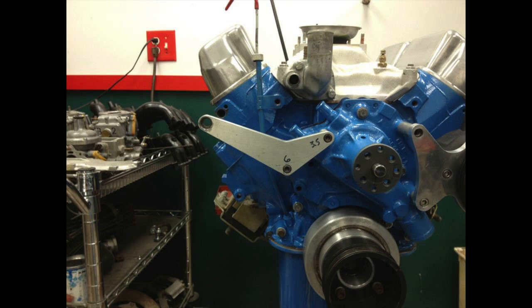Now, remember what I said earlier about the builder's standards of construction may not necessarily be up to yours? Well, this is an example of one of those cases. What you can see here is the stock alternator bracket that was provided with the kit, and the big hole in the outboard end is for the lower pivot. The problem is that the owner is responsible to come up with some sort of an adjustment link up at the top, and they provide the link, but in terms of actually mounting it to the engine, that's kind of up to you. This guy had basically used threaded rod and washers and nuts for spacers, and the belts weren't aligned properly with the pulleys, and it was just not a really good thing.